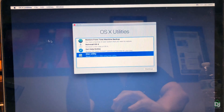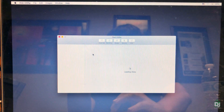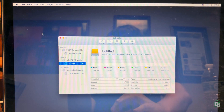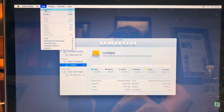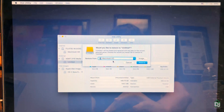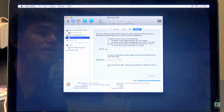I would be remiss if I didn't mention the newer firmware on MacBook Pros. With the SSD selected and the hard drive we want to image, go up to Edit and hit Restore. It's going to ask where you want to restore from — select the hard drive and hit Restore. This is going to take about an hour depending on how slow and how bogged down your hard drive is and how much stuff you have on it. We'll cut here and come back later.